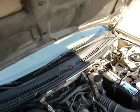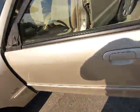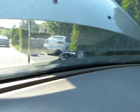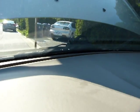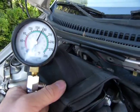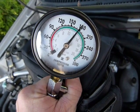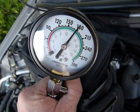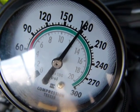All the spark plugs are removed. All I need to do is crank the engine and take a reading. It takes two or three crankings for the pressure to build up. I can see the gauge — take the key out and let's take a reading. This one reads just a little over 175 but not yet 180 — how about 177. Okay, on this one: 177.